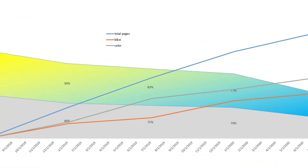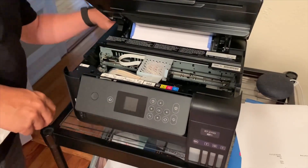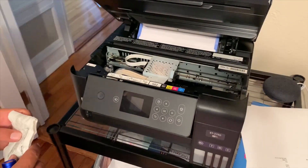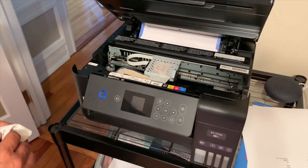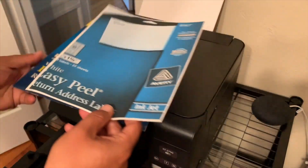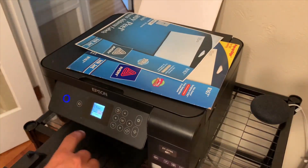Looking at the usage chart over time, you can see that in the first year I don't burn too much ink. It's really not until about 18 months of use that I start going through more ink. It's very important with this printer that you use it frequently — the ink has to always be moving through the printer, through the print heads, through all the hoses from the ink tanks, and spraying through the print head. If that action isn't happening at some periodic rate, you can get air in the lines or some areas might dry up and harden.